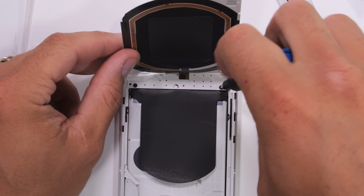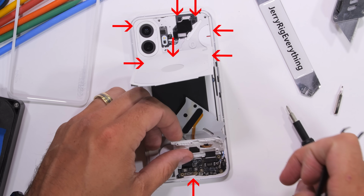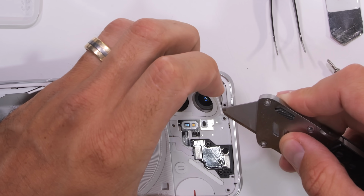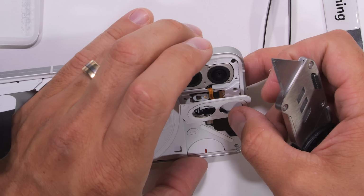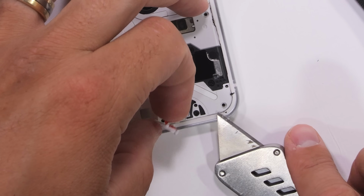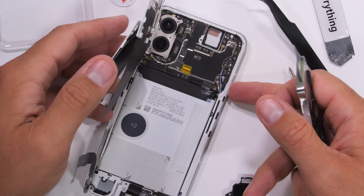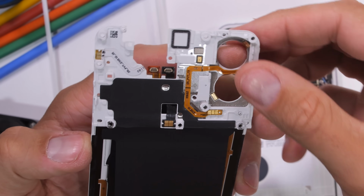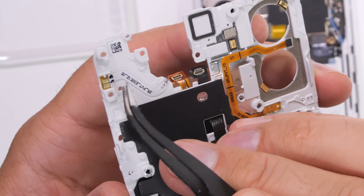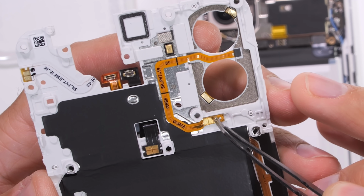The LED layers are not one uniform board, but actually several separate components, and are hiding 8 more black Phillips head screws throughout the layers, making disassembly slightly more painful, but I've been told that beauty is pain, and getting to see some of the insides from the outsides is totally worth it. The red recording LED filter comes off with some persuasion, followed by the wireless charger and several of the LED strips. Most of the LED zones have a singular gold contact pad supplying power to the strip, but the more complex zone, like the progress bar in the top right quadrant of the charging pad, has its own Lego-style ribbon, which is able to handle the 16 addressable zones in this section alone.